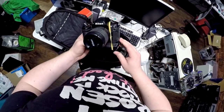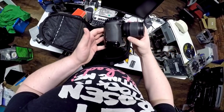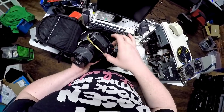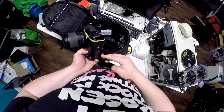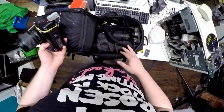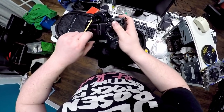This guy is a Nikon D1X. You can see there are several things going on here that are perhaps not factory. Same sort of thing — at some point it was a Nikon film body, but it's long since been transmogrified. The battery pack it came with was completely proprietary — it's 18650 cells, which I'm not willing to touch in any deep intimate way except to gut them. I had two of these, neither worked. So I pulled one out, gutted it, took the batteries out, and put in a bypass with a lever lock. I had a Sony InfoLithium sled rubber-banded to the bottom and then lever-locked on. Super safe — and it worked quite well. Well, this camera never worked quite well. It was just okay.